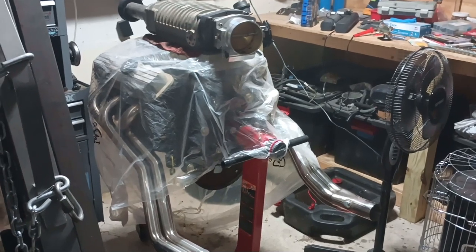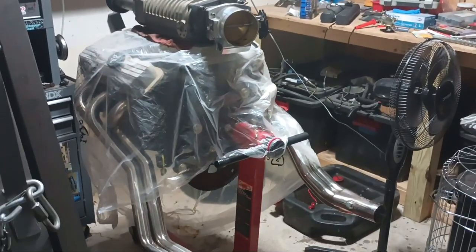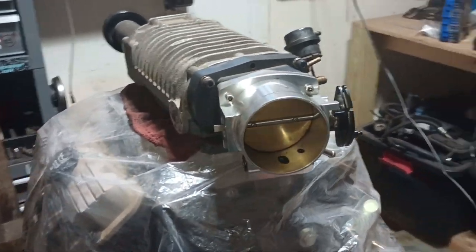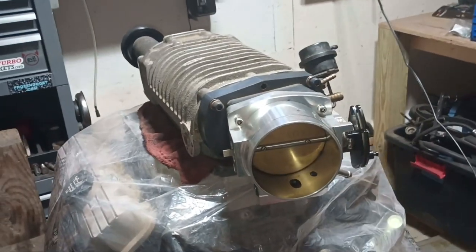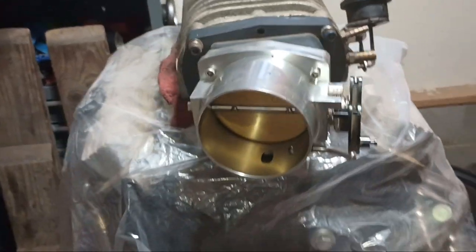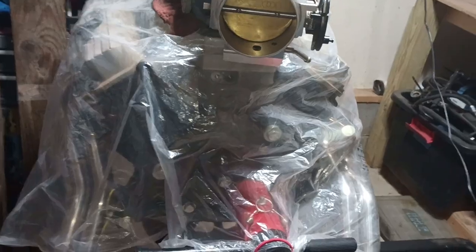Welcome back. As I said in the last video, I'm going to give you an update on where I was getting parts ready for the rear-wheel drive 3800 supercharged project. We obviously have a nice set of headers. I've got a big bore throttle body — 102 millimeter LS style — that is mounted to the old adapter that came on the original kits from ZZP and Intense. I'll probably have to make a newer one that pushes it up closer so we have a lot of space back towards the firewall to make our J-tube or whatever kind of inlet turn we need.